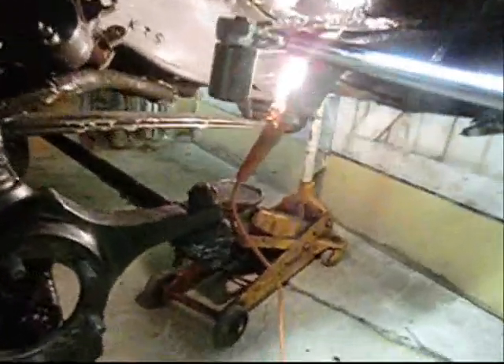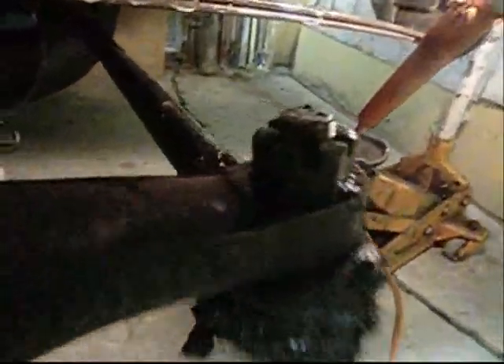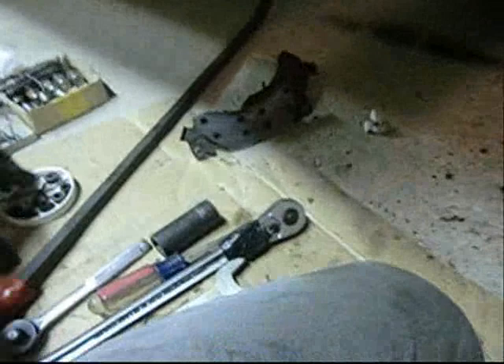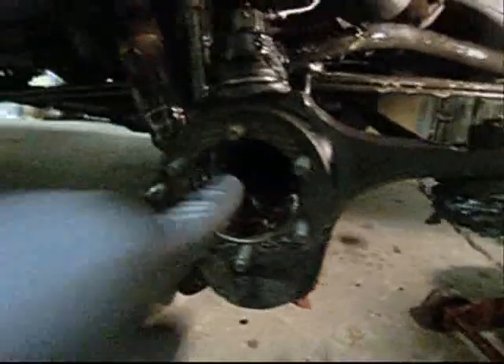I say as long as it's tight. I bent over the leg of the cotter pin, hit it with the hammer, and busted one of the legs off. But I don't think at 100 foot-pounds it's ever coming loose. Maybe I'll stick the old rusty one in — 28 years old, still usable. Put it back in the tie rod hole. Still good. Next axle.